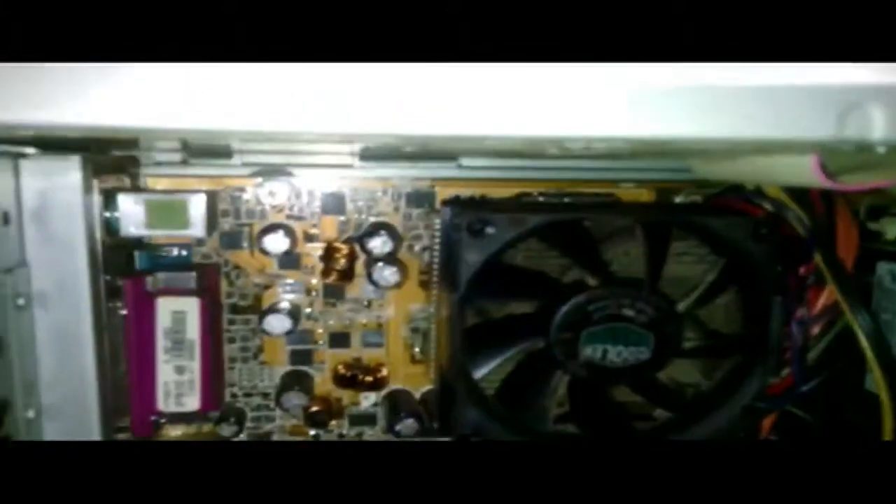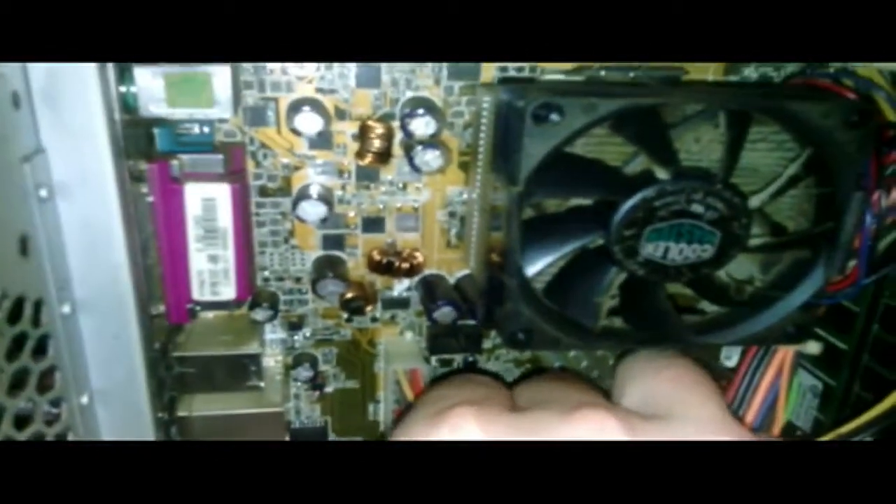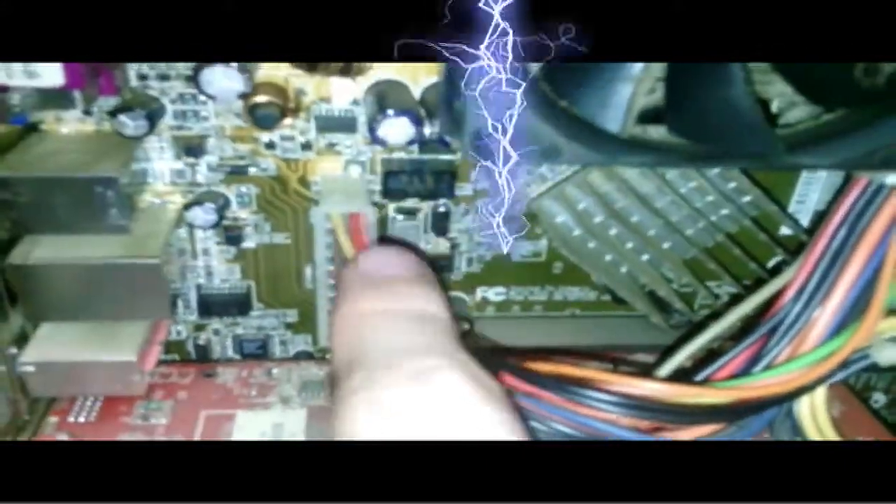If you've gone through all this and you think the power supply is okay, the next step is down at the motherboard. I'll do a visual inspection — make sure that everything's tight, your RAM is seated and not loose, you're firmly plugged in, and your processor isn't loose. If your processor or your RAM is loose, it will either not power on at all, or it'll power on but won't do much beyond that. If your power supply isn't fully seated, you're either not going to power on at all or you're going to get a short.